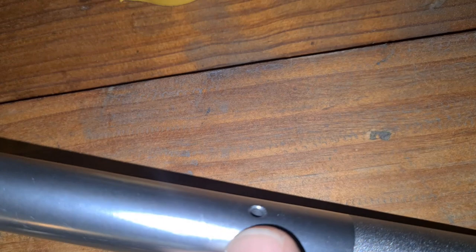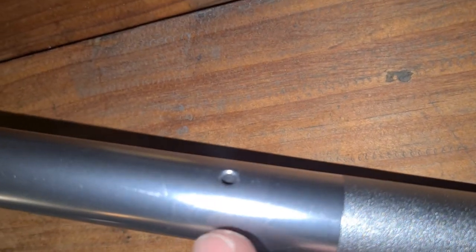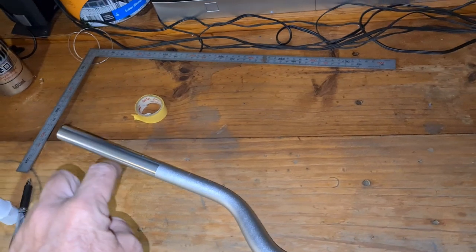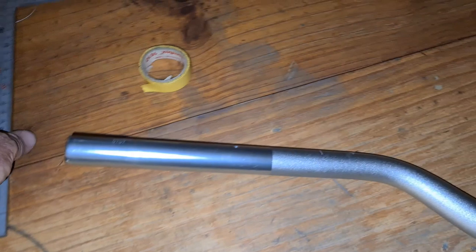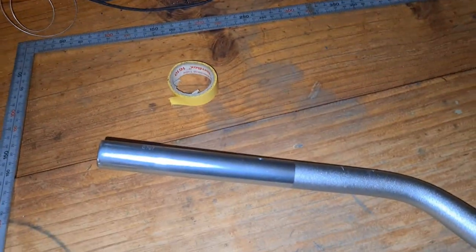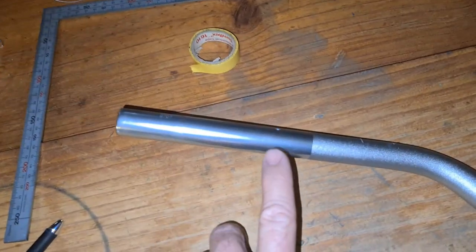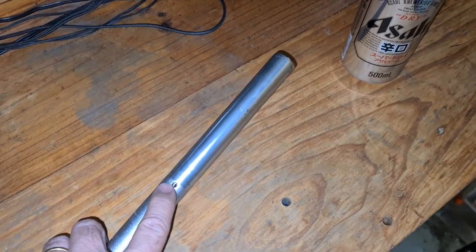Here are the stock bars on the left side. You'll notice the hole that's drilled through — hopefully the camera will pick it up. That hole is actually threaded, but the threads serve no purpose, so you don't need to tap the hole you're going to drill through your bars. What I did was measure with my square from the outside of the bar to the center of the hole — that was 119 millimeters on the left side and 146 millimeters on the right. Do your own measurements as they might differ slightly.